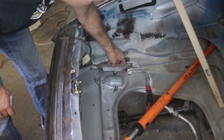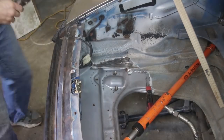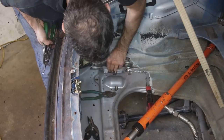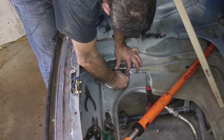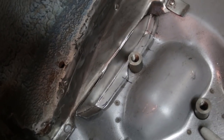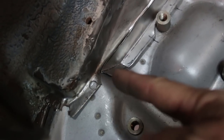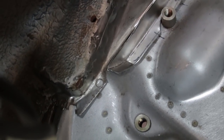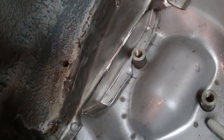I'm going to put some relief cuts in here because it'll go faster — I'll weld up the cuts in the end. If this were an external part that was going to be seen, I'd spend the time to form these around properly. It doesn't fit at all; I need to make a little moon shape around this bowl. Getting ready to tack weld this in place — I completely messed up on this section. I cut it at the wrong angle, like a pizza shape. I should have cut it the other way, so I'll have to splice a little piece in or fill it with plug weld.